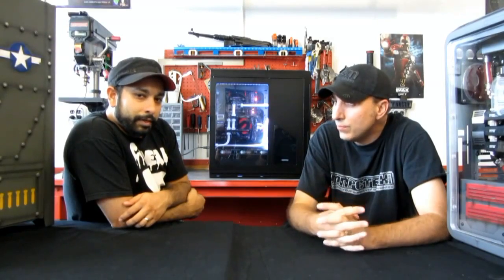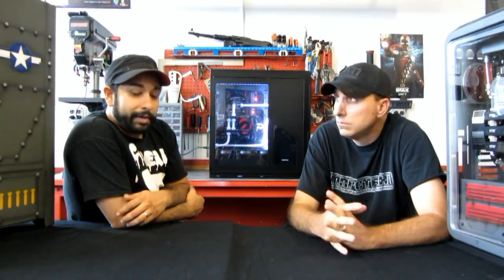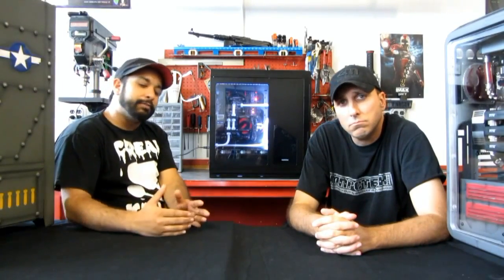Overall, it looks to be really what we've been waiting for on the market. They put a lot of thought into what a beginner might want. This is a really great case for a beginner who wants to get into water cooling and is kind of scared as to whether the case will fit what they want to try out — the Enthoo takes care of a lot of those things. There are a couple of issues: I would have loved the case to be slightly bigger so it could accommodate a thicker tube reservoir without issues. I personally love tube reservoirs because they're easier to bleed and I think they look better than a bay reservoir. As of now, I have my tube reservoir mounted in the 5.25-inch bays.